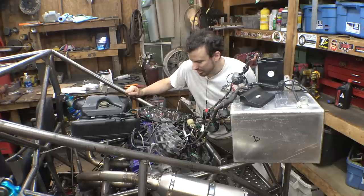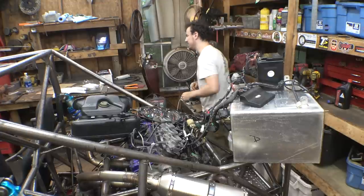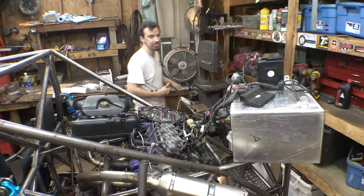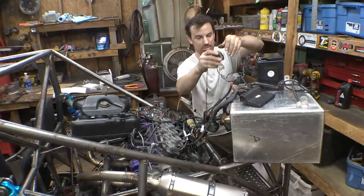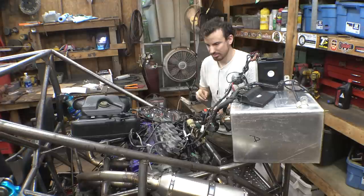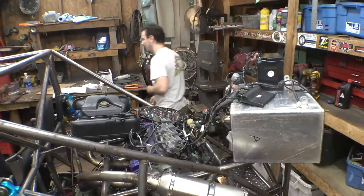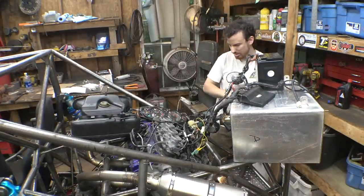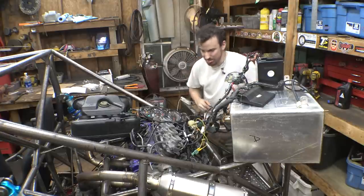Alright, what is not working? Is there a kickstand sensor on this? GP sensor, there's actually, wait a minute, there's this. Hang on. There's the tilt sensor. That has to be up. Still no spark. Let me check for kickstand sensor. Kickstand switch is bypassed. I also found a different sensor, the temperature sensor.